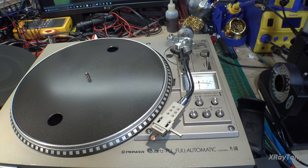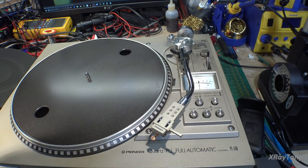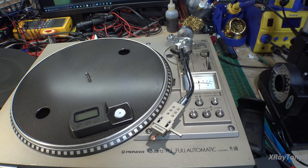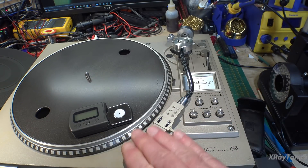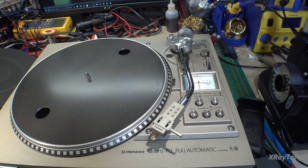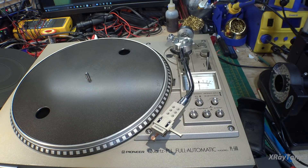By the way, the reason I removed the platter mat - as I said in the last video - is when you look at the thickness of the platter mat and the thickness of this, they're very close. You want to measure at the same height that the record is going to be. By removing the platter mat you're making it a little bit closer - if you measure it higher or lower, the weight actually drifts very slightly. Sometimes with a really thick platter mat you may need to leave it on. By the way, this thing had two platter mats with it - a really thin one and a really thick one.